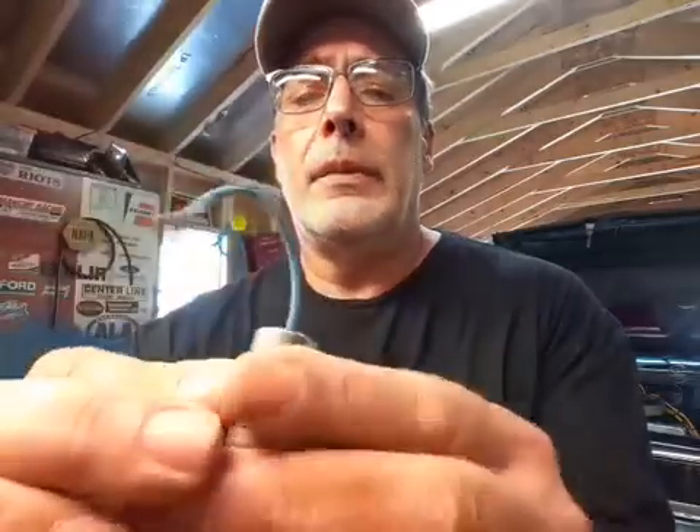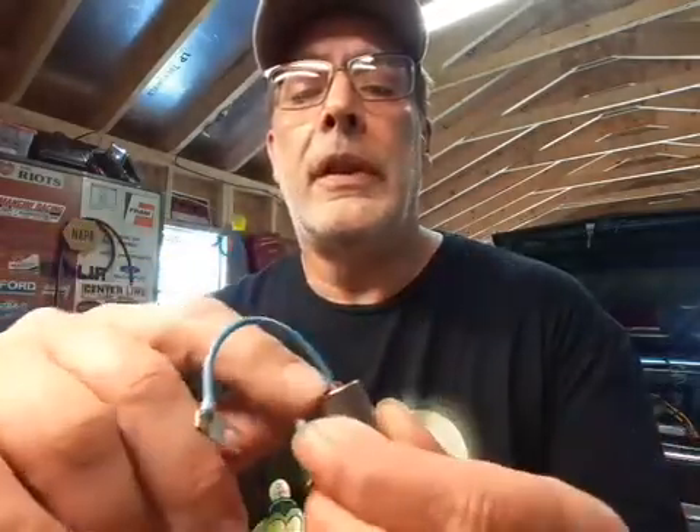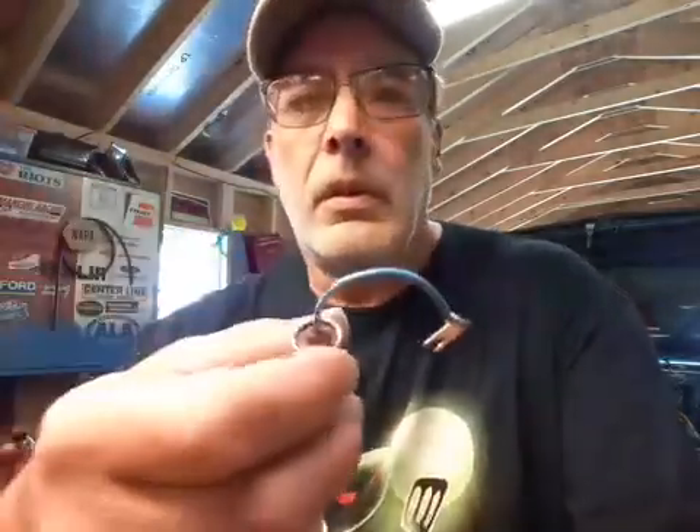And that's all it takes to test the condensers. I guess they're not sealed very well today — they're not made very well — but they're not in demand anymore. So what I'm going to try is when I use a new one, I'm going to see if I can get a little bit of something — even if it's just Elmer's glue — just put it right around here to seal any moisture out of it. I'll probably use silicone. I guess that's part of the issue, since we don't drive these cars every day like back in the old days. Most people don't.